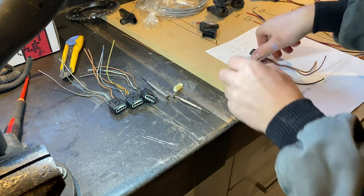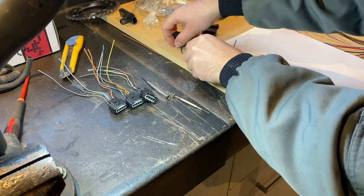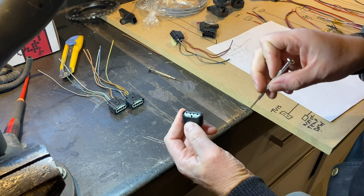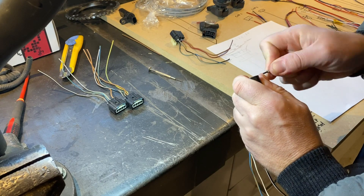These are the connectors from the new coil-on plugs. I'll be reusing the pigtails on these, and as these are four-wire types, I'll get rid of the check wire as it won't be needed. I'll go into detail about the 3 and 4 wire types and what type of coil-on plugs I'm using later on.